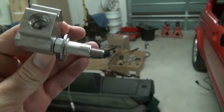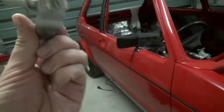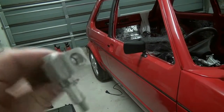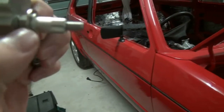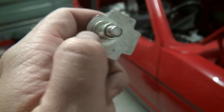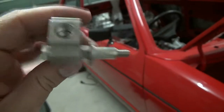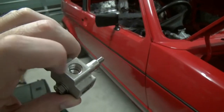I haven't decided yet - so the one needs to kind of go in this orientation, and the other one would need to go upside down, which means I need to do a couple of weird right angle bends. What I could do is stick one almost flush mount against the wing using the oversized washer and then the normal size washer on the inside, just to space it away from the body. The bottom one I was going to use two nuts stacked, so they'll be staggered and I don't have to do any crazy right angle bends.